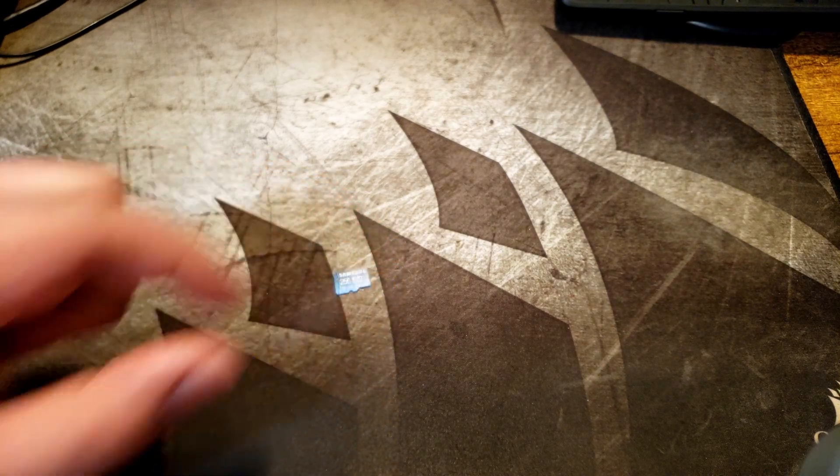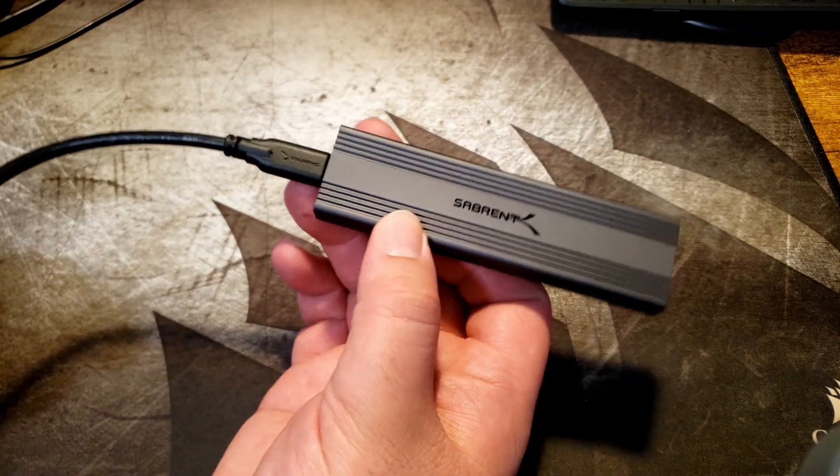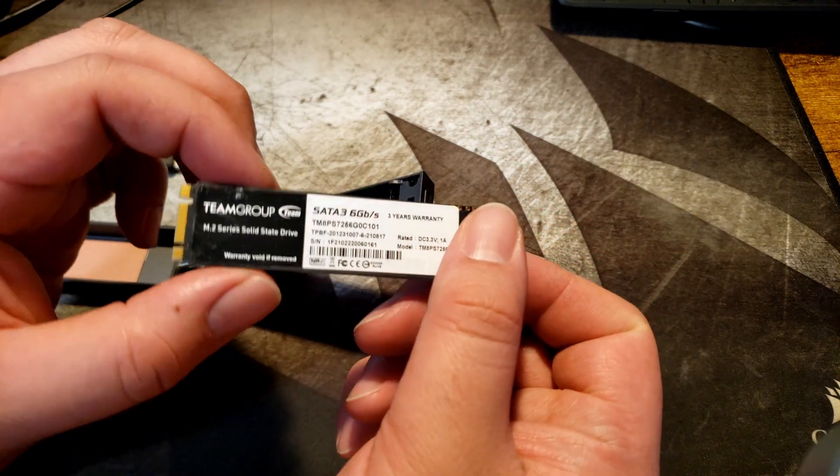Hello, Spice Vader here again. I just wanted to make a quick video on doing a Windows to Go install on a micro SD card, showing the process of using Rufus to set that up. You can do this on a USB drive, an M.2 drive in a USB-C enclosure, or even a regular spinning disk SATA hard drive. I wanted to make this specifically for the Steam Deck, but you could use it on anything.